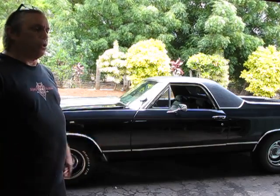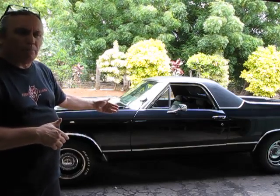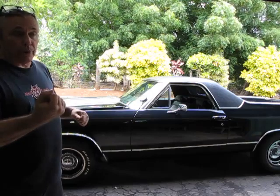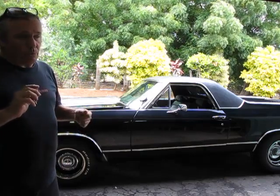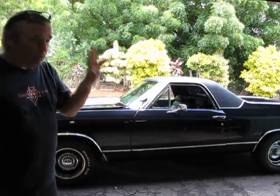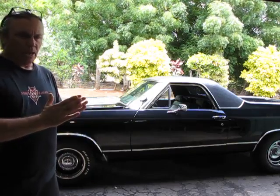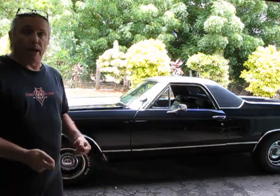In the end I decided all this is way too technical and it's pretty expensive. It's a four-speed, but without cutting a hole in the floor and putting in a floor shifter, you could never use first and second. The premise is to get four speeds on the freeway — you put it in drive and really don't intend to use the separate gears. After dialing in the TV valve and seeing all the weak links, I said I'm just going to go back to the 350.